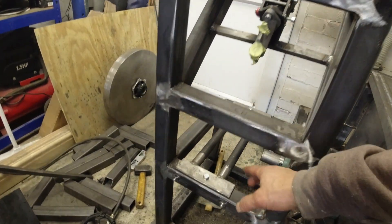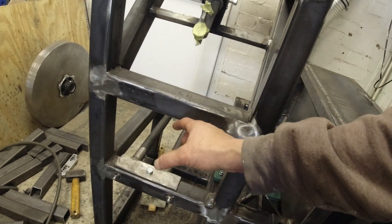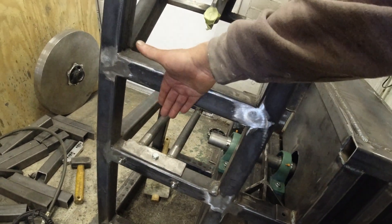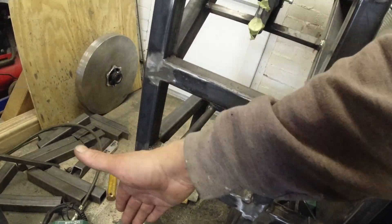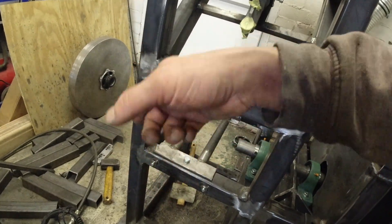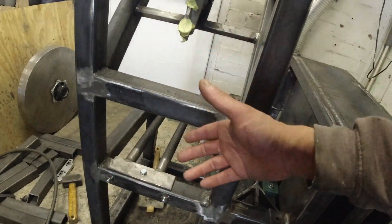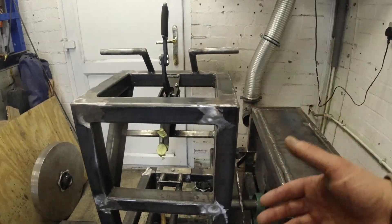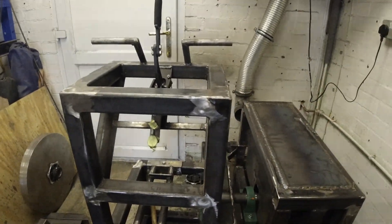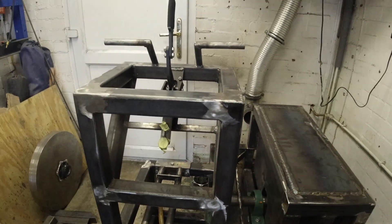What I've got to do now is cut some metal to make the bulkhead protection on the inside, then weld in some sort of tab to allow the fuel tank to be mounted on this side. It's going to fully simulate the scenario of a go-kart - the fuel tank's at the front at the same sort of height, and the fuel pipe will go through there with the filter, exactly like you would have on a normal car chassis, for a real like-for-like comparison. The only thing I can't replicate is the airflow. Let's get some more metal cut, do a bulkhead, and hopefully get some paint on it.